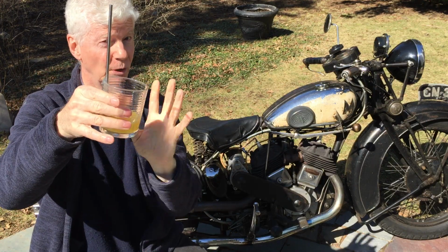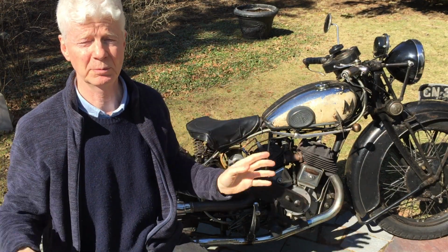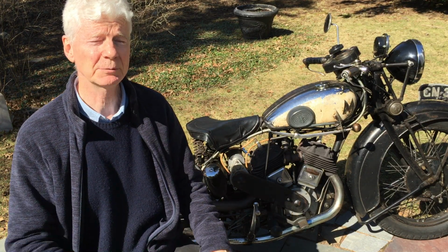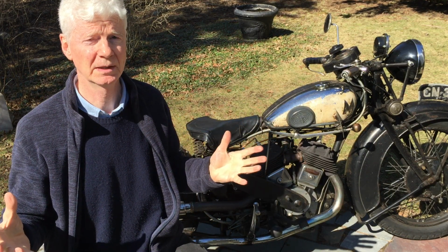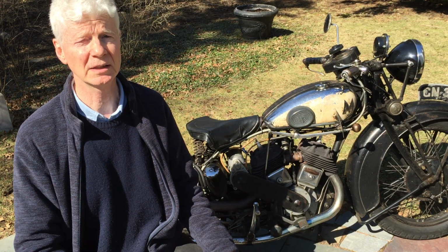Now, if this were oil, that oil would be thrown around inside the motor, and too much of it would go on the cylinder bores and presumably elsewhere in the engine, like into the pressure release valve, and would cause this motorcycle to smoke horribly. And that was what the problem was. In fact, not leaving the motorcycle on its side stand solved the problem.